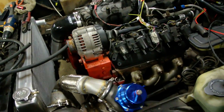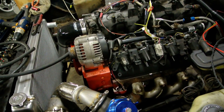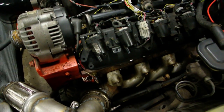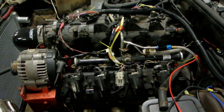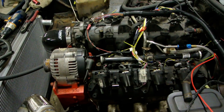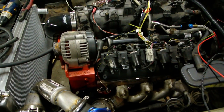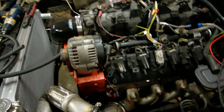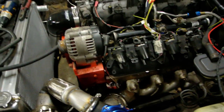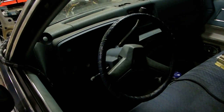What I want to do is, we had a lot of junk in the pan from putting the motor together. Studs, scraping everything off, blowing everything into the lifter valley. You know, the quote-unquote lifter valley. It's not really lifter valley like old school, but everything's in the oil pan basically. Lots of dirt, sludge, and grime. So I'll probably pour like a couple quarts of used oil right into the cover here and fill it up and then drain it just to get some of it out. The rest of it will get picked up in a fresh filter and everything else. But what a nice car, what a nice car.